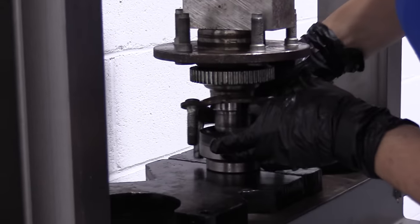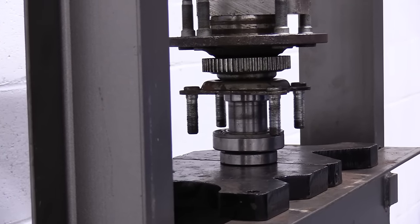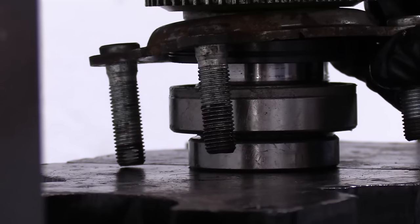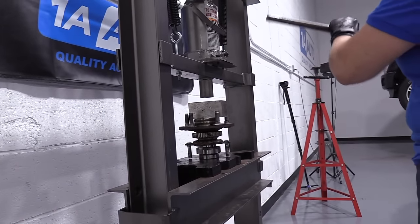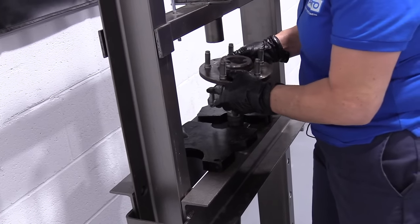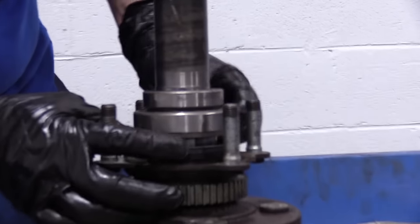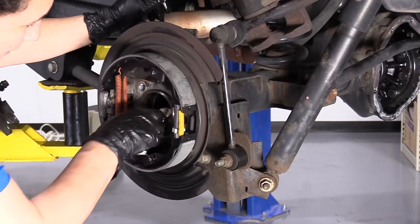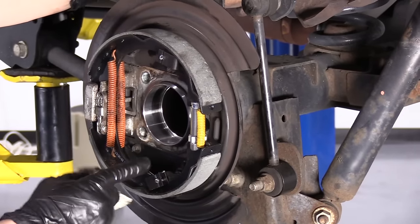It's important to make sure that seal is back up in there sitting flush. And there we have a new bearing and seal pressed right on. Now I'm ready to put the axle back in, and I'm just going to clean in here because as it's been sitting, the axle fluid falls out. With the axle out, I threw new e-brake shoes on and hardware. If you want to see how to assemble those, there's a video with the actual axle in on the other side, because if you're not doing axle bearings, you'll need to know how to do it with the axle in.